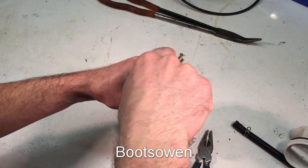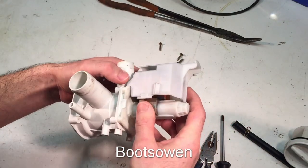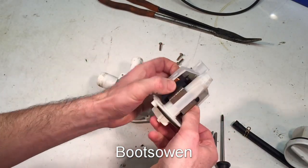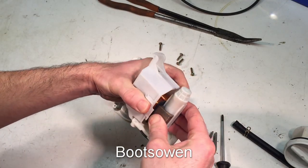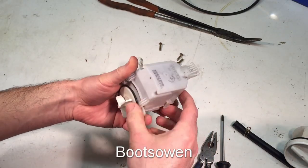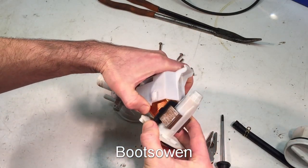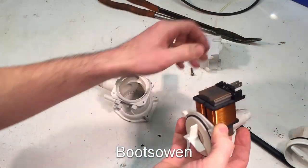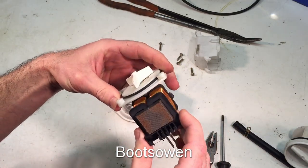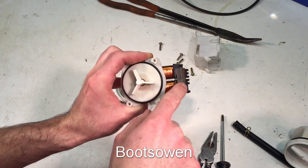Most of these pumps are pretty similar. The way they work is you've got power coming in here. Let's get this cover off — snap these sides off. There's the pump off as well. So this is the whole motor. Snap these two sides off, and then that rotates up and out. That's the drain pump on the WFF 1401. Without damaging the coils — that's just a rain cover in case the machine leaks. You've got two coils of wire around a magnetic ferro core, horseshoe shape. Do you see that U shape there?